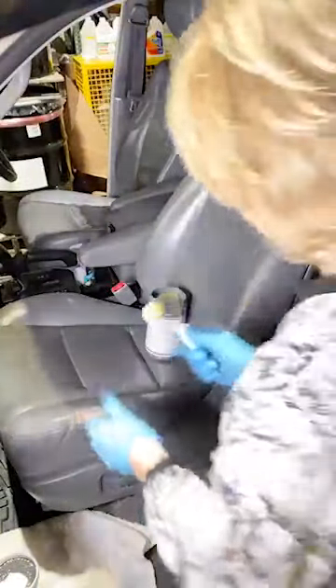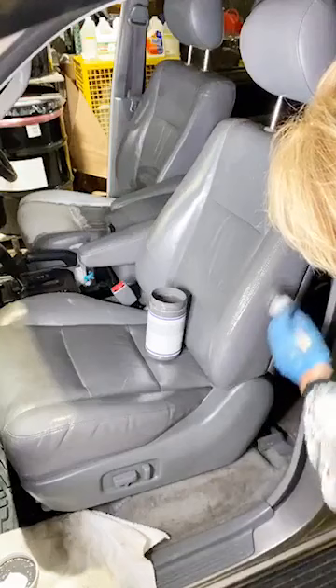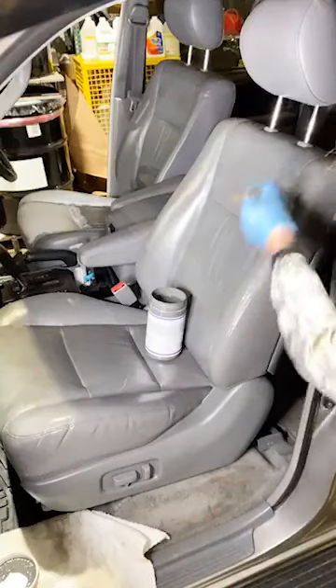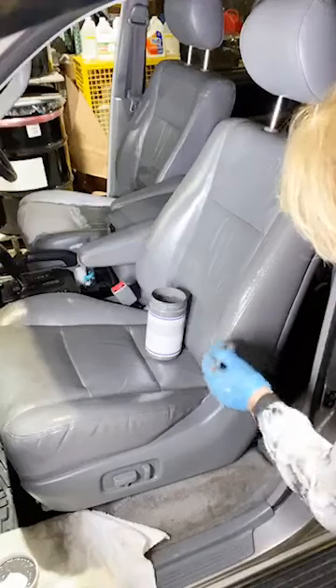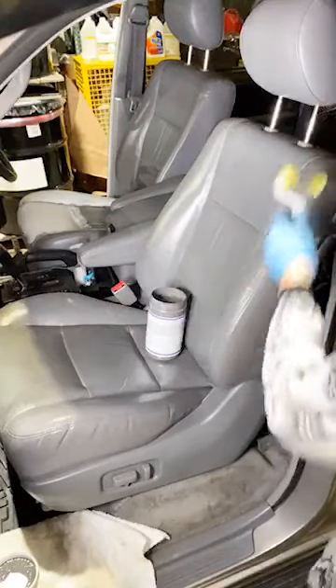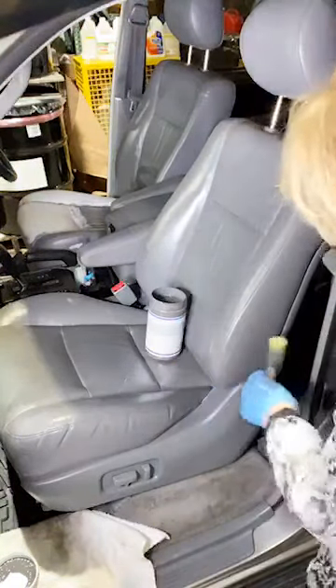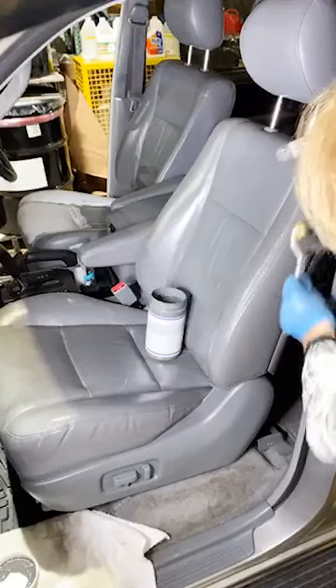It's a very smooth surface — it's been laminated with the vinyl so it matches the door panel. I put the product inside and outside of it so it's got some strength there. I've sanded it back already so it's ready for paint. This is a beautiful match. This area doesn't even need any paint, but I'm going to show you how great this matches. That's not always going to be the case — you're not always going to get a true match — but there are a lot of great automotive colors, and you can also custom match them.